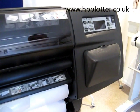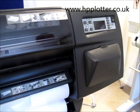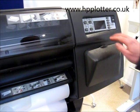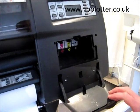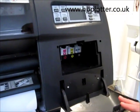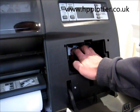What we're going to do is attack one of the basics of that problem, and that is to oil the slideways. First thing we do is open up the printhead cover — this is with the machine turned off. You shouldn't do this with the machine powered on or you will damage the Designjet. Then pull the service station forward.